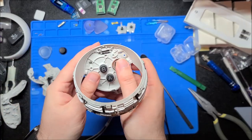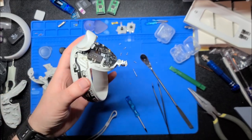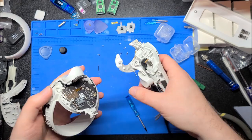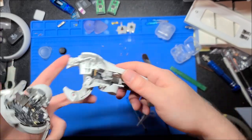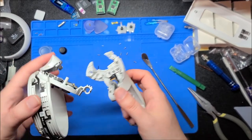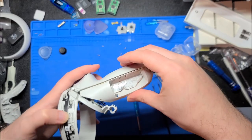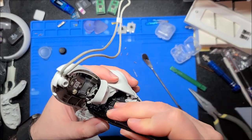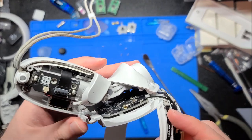Now we're going to check that all buttons still click and none are stuck. New joystick wiggle-waggles — we're good to go. Now we just reverse everything, which for a couple of things is easier said than done. We need to fit this ribbon back in — like I said, this would be a lot easier if you figured out how to remove the backside grip, but I'm going to hard mode it. We need to get this re-situated and make sure this ZIF latch is up so the ribbon fits in.